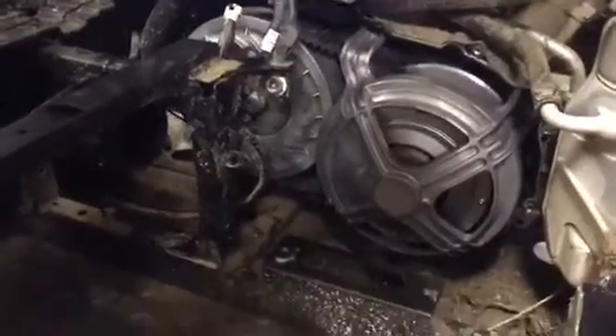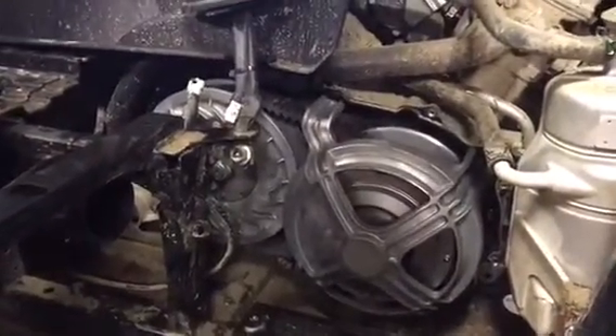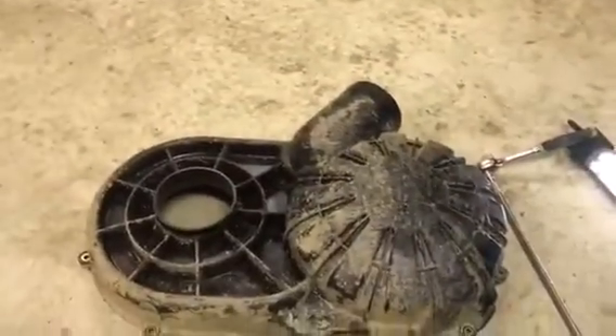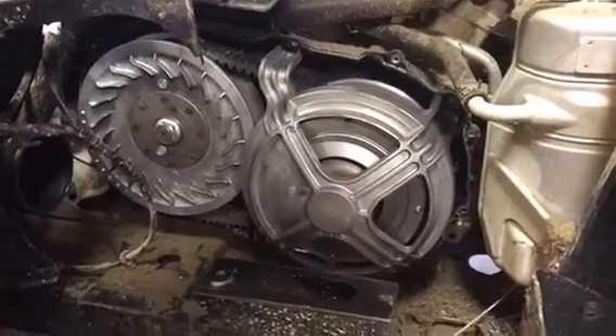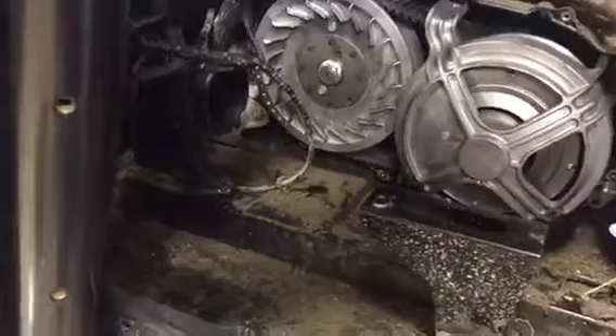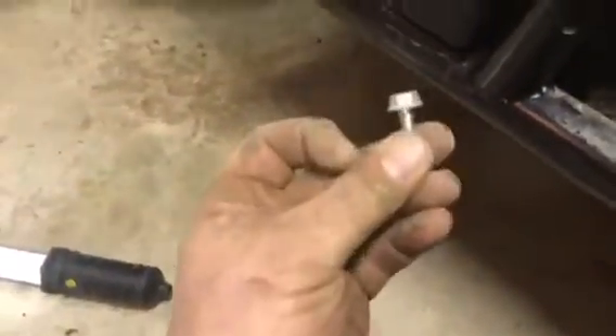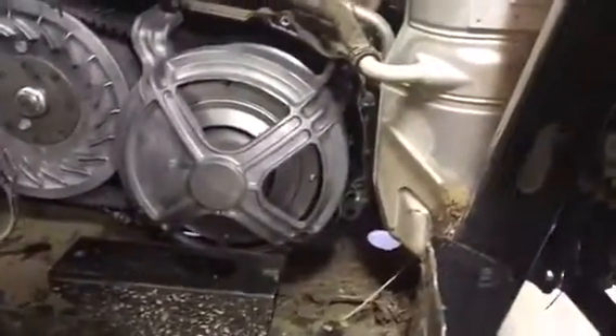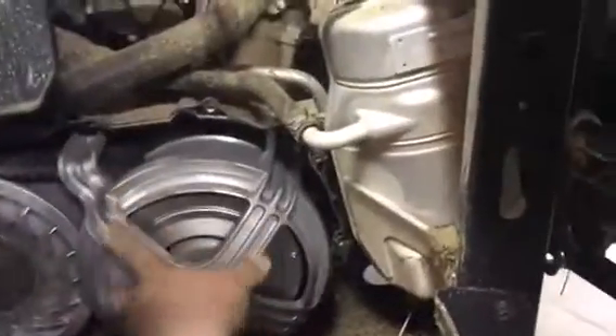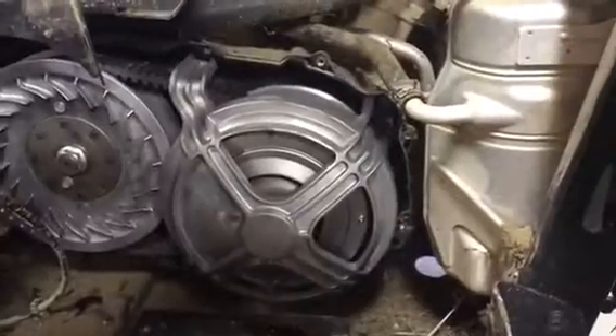Okay guys, once you get the exhaust and intake boots off of the outer cover — there's the cover there. The cover wouldn't come off without taking this bracket, the seat bracket, out. There are two bolts on the bottom, one bolt here, and one bolt here, and then you can basically flip it out of the way to get your cover off. I did use one of the bolts out of the primary cover — it basically goes right into your secondary and you can screw it in to loosen your belt. I'm gonna pull the bearing support — this piece off, there are four bolts — and then we'll get into the guts of the primary and get these weights in.